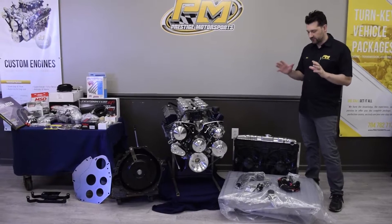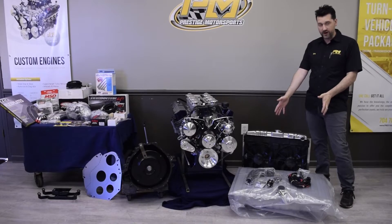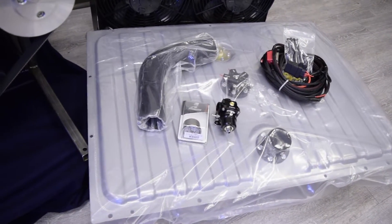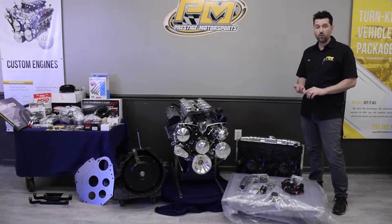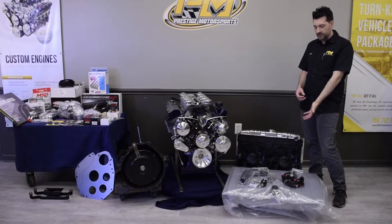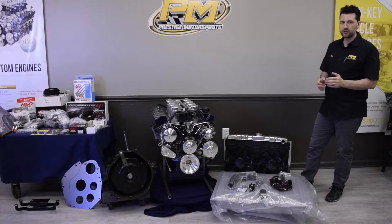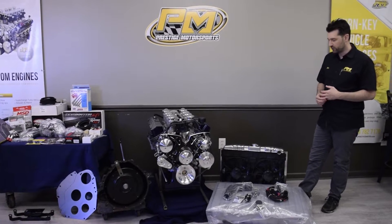This fuel supply system is a complete fuel system for an EFI engine. It has a brand new tank for your Mustang with the electric fuel pump installed in the tank. It comes with all the line fittings and everything you need to install it. It also has the gauge sending unit installed, a wiring kit with all the wire and relays needed to wire the electric fuel pump and the sending unit. It also includes the high-pressure fuel regulator and a gauge so you can monitor fuel pressure.